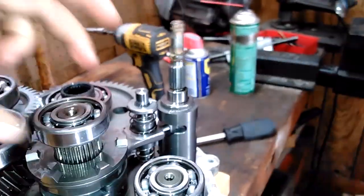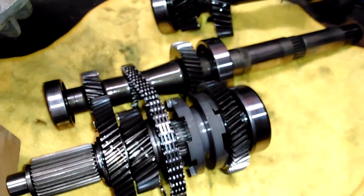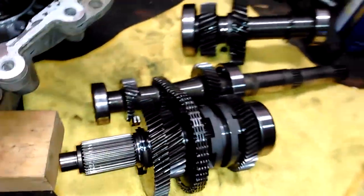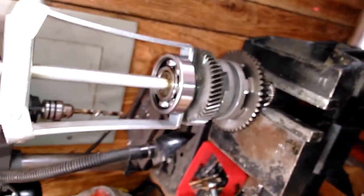You have to use a bearing puller. I'm hoping to do it all with this little tiny puller I got from Advanced Auto Parts for five bucks. First you pull the shift forks, then you press or pull off your top bearing with your puller. As seen in Solitude Customs' video, there is enough room to pull out all three shafts without messing with anything else — though you almost need a third hand. Your end game is to change out the reverse shaft and this gear — that's the gear reduction. I maxed out the puller and it wasn't doing it; I applied just a tad of heat and it popped up an eighth of an inch. Heat and pressure — you can do a lot with heat and pressure.